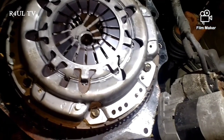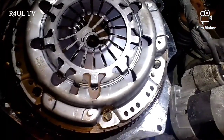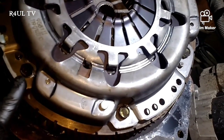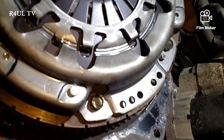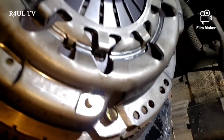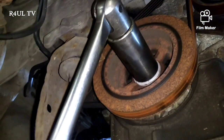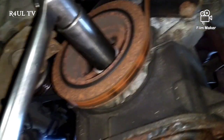All we need to do is get it bang in the dead center with the input shaft. You can possibly buy the proper tool for it, but it's not really worth it - use your eyes, feel it on the sides, that will give you a rough idea where it's supposed to be. An important note I forgot to mention - when you're taking the bolts off on a chain-driven engine, you don't want the engine to go backwards. If you've got a loose chain, you could jump a tooth and then big trouble. What I find easier is take the wheel arch cover off on the crank pulley, get a 27mm socket on it with a strong arm, and get an assistant to hold it there while you go tighten the bolts up or take them off. That way the engine can't move.